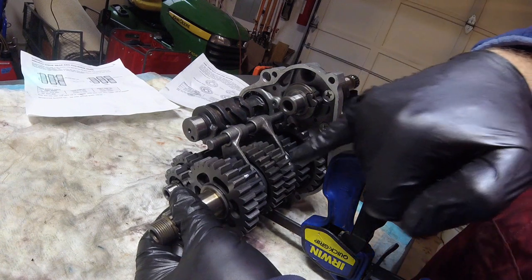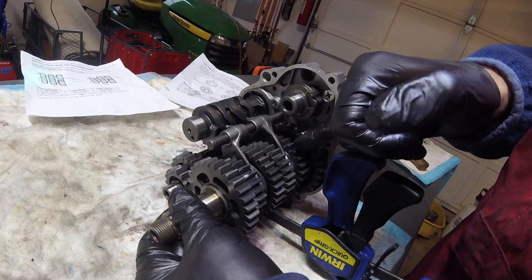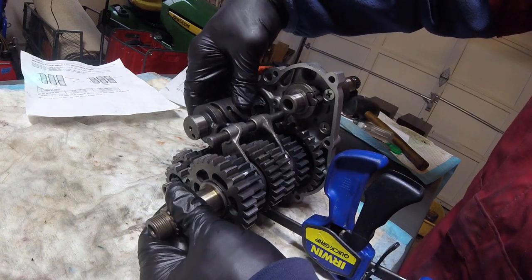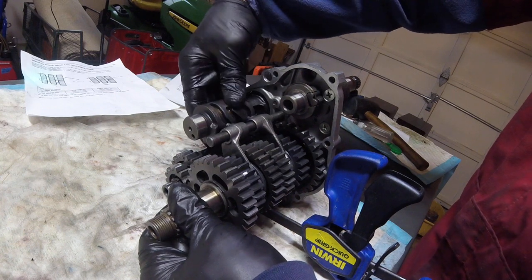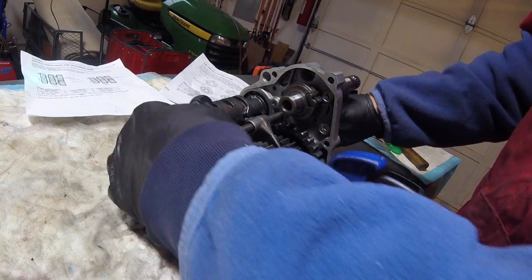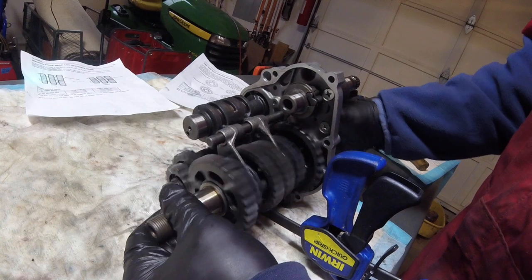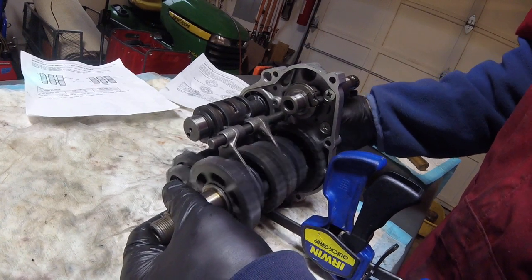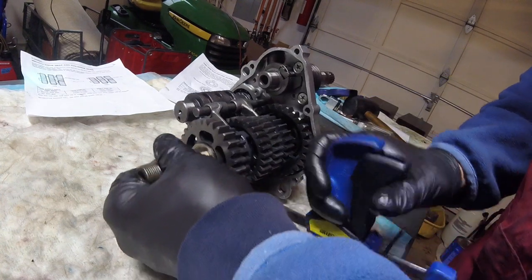For fourth, this dog needs to slide across the other way and lock this gear in — probably the biggest travel of all of them. Disengaging third — there we go, that one's engaged. We now have fourth gear — fantastic. That's really what this side of the gearbox does.